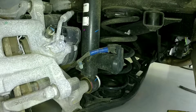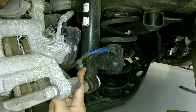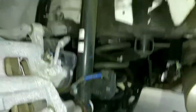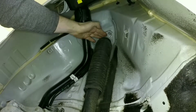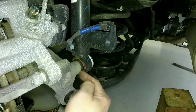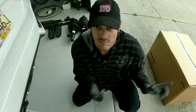To remove the rear shock and spring, first things we've got to do is remove the electrical for the dampener along with the pigtail for the wiring harness — make sure that nothing gets hung up. Then we're going to disconnect the sway bar end links to allow the lower control arm to pivot, and with it safely supported with the jack, we're going to remove the two 12-millimeter bolts up top that are holding it into the chassis. When we lower the jack that will separate it from the car, and then once the spring is out we can get the 19-millimeter bolt on the back here that will remove the shock from the rear hub assembly.